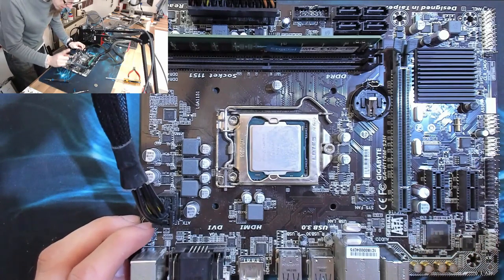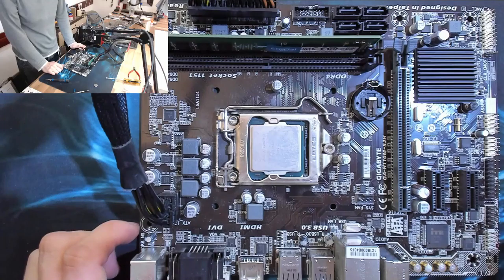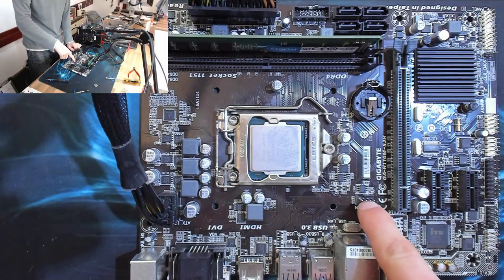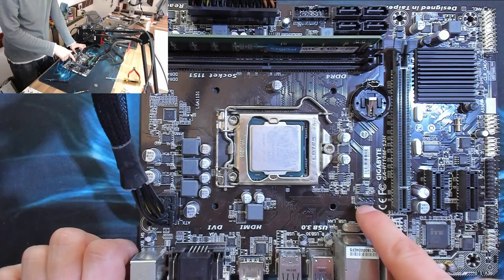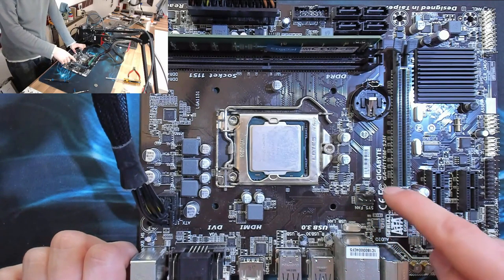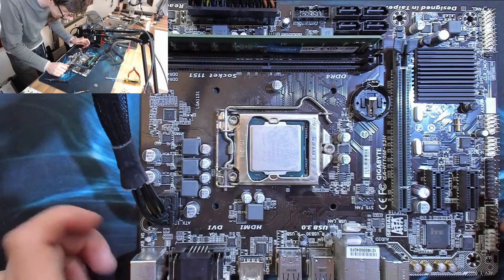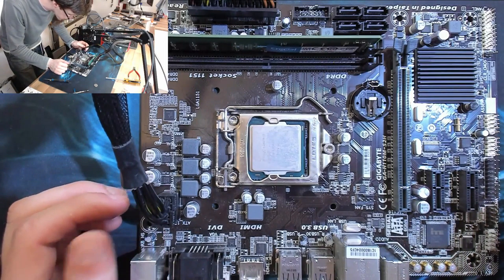One thing that I have legitimately seen before is someone connect the 4-pin floppy drive power connector to a 4-pin fan connector, because the floppy drive power connector, although it's not supposed to connect to one of those, does happen to be exactly the same size. And I have seen someone just plumb 12 volts straight into a fan header and they've blown up the motherboard that way. So I wonder if something like that happened and there's just something that I've not been told.